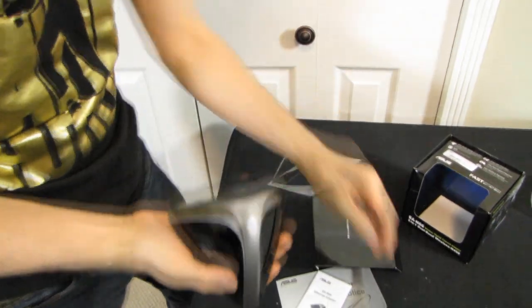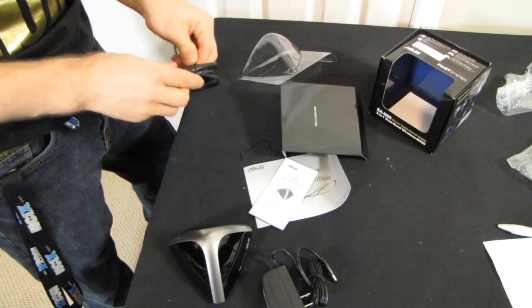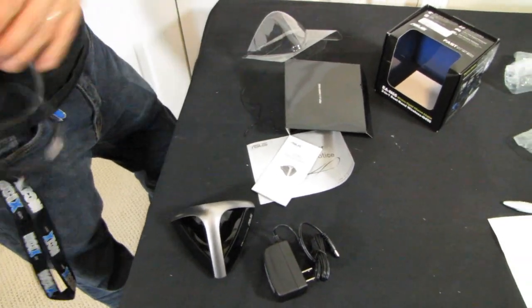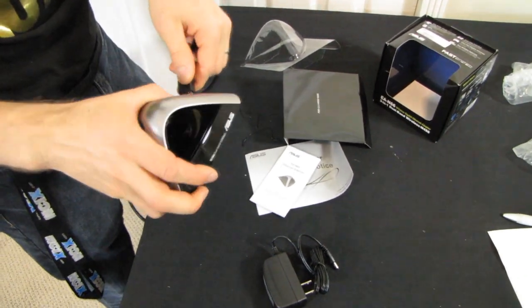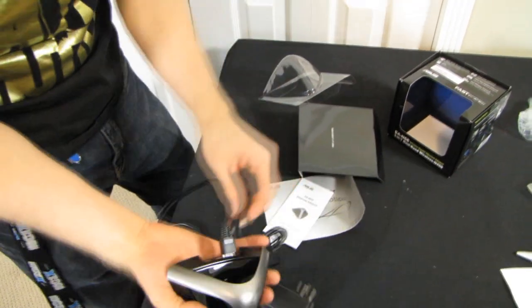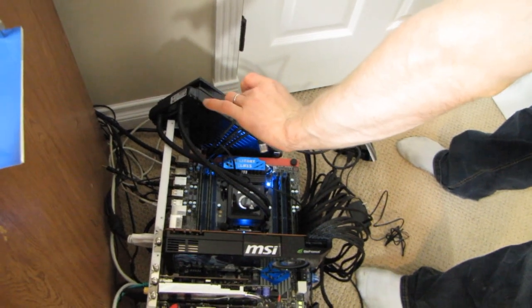So what is special about this? Three different functions. One, it can act as a network adapter. So the way you'll do that is, okay, I need wireless networking — we're going to do real world examples. I'll plug this ethernet cable in a little bit better so it doesn't fall out, and I'll plug in the power. Then you pair it with your router using WPS, and then you plug it in via ethernet to something that needs wireless network connectivity. Boom — wireless network adapter.